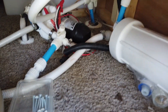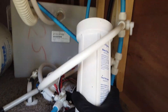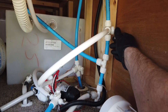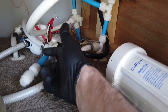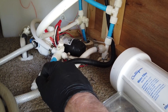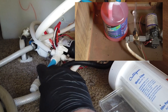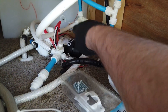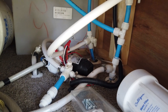In here we also have our water pump. There's a water filter, though it doesn't appear connected at the moment — it'll go up there. You do have an onboard water filter, and a lot of these have a bypass so you can bypass the filter if you need to change it out. There's also a little stem that goes into the water pump used for winterizing — you can attach RV antifreeze here, open this valve, and it sucks the antifreeze in through and puts it into all the pipes in the RV. The water pump runs off 12 volts, so it works off the battery and you don't need to be plugged into shore power to use it.